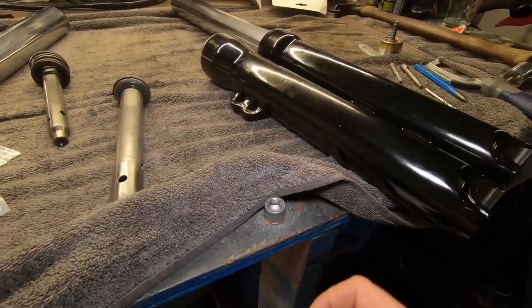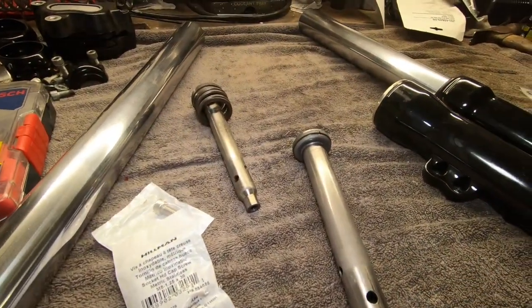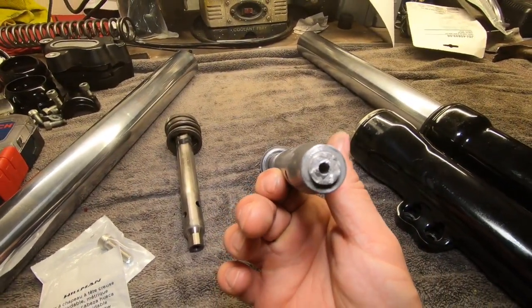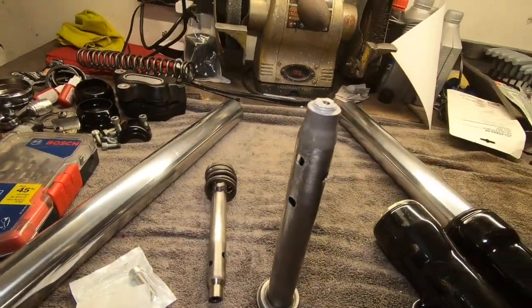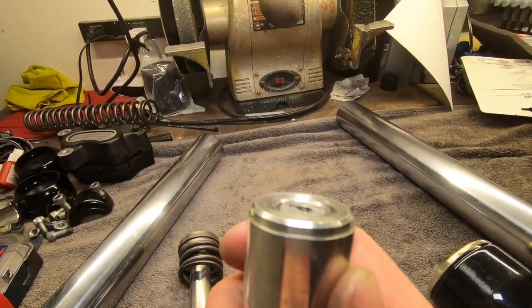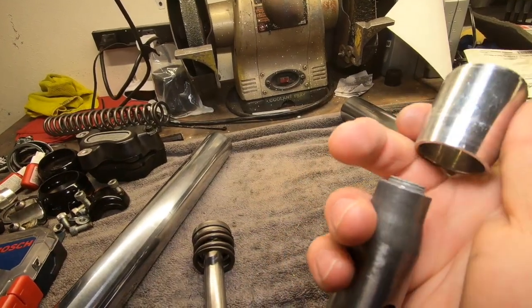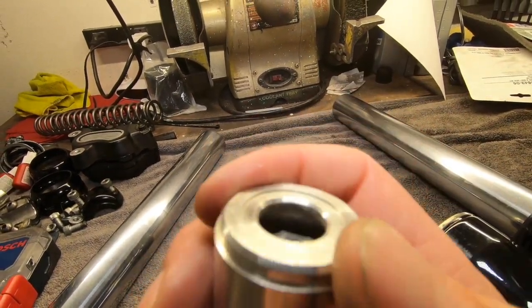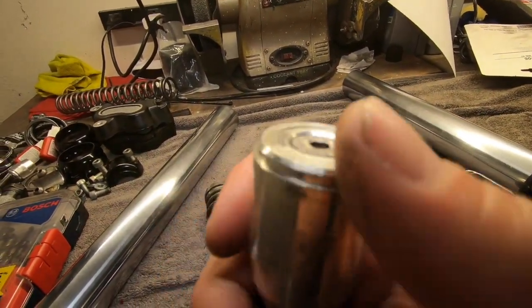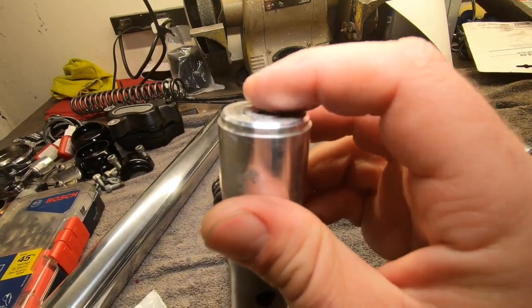My original dampeners are going inside the dual disc V-Rod front end. All I need to do is get a reducer. I went to the store and got some M8 x 1.25 by 30mm screws. I'm going to tap it and run it down. I cut the bolt, put it inside, center-punched it, and started drilling out from a small bit, trying to be as even as possible — back and forth. I don't have a drill press so it's not perfect, but I think it'll be good, and with the extra little lip it gives it some extra support.